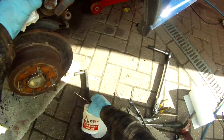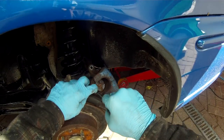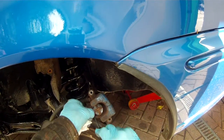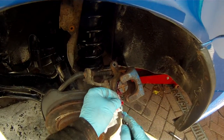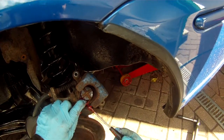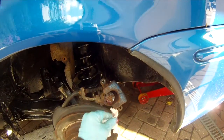Get a little scoop of rubber grease — it looks after all the seals and rubbers and lubricates as well. Don't need to push it in all the way around because we're going to be rotating this piston in the caliper to push the piston back in again. Unlike the front calipers, the rear calipers you have to wind clockwise to wind them in. Try and push some of this grease in, taking care not to get any grit in there.